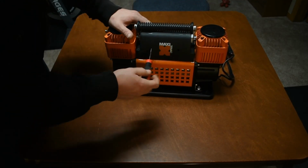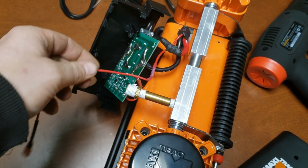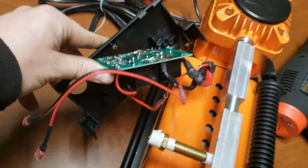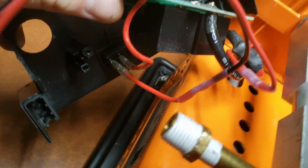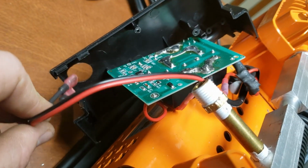There are 4 screws around this plastic cover and 2 in the center. Removing this gives access to the wiring and plumbing guts. The pressure switch needs to be put in line with the main switch to control the power. I'll run the ends of the wires out the pipe hole in the cover. The factory hose needs to come off to allow for the manifold to be installed.